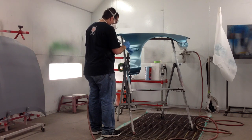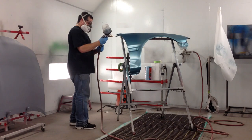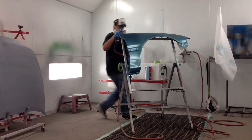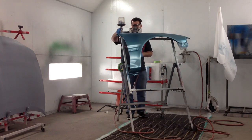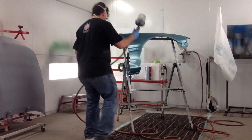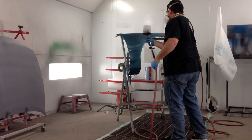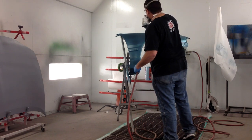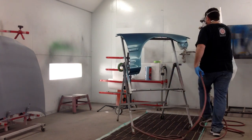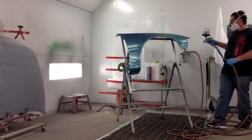Right here I had a little bit of dirt, a few things in it, sitting on top. So I just used a tack rag to kind of wipe them off. Now if it was embedded in there I would need to lightly sand it and then put another coat on. I'm putting the second coat on, doing the same thing, going around the outside edges, and then I'll do the center section. And I'm going to go out a little bit further with this blend, but I'm still not doing the entire panel. Getting all three spots, getting another coat on, and now I have to come back and dry it again with the air dryer.